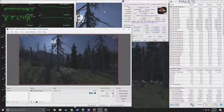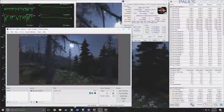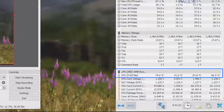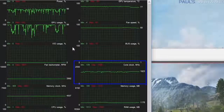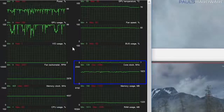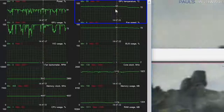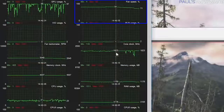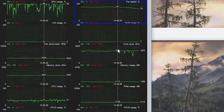In this test I saw an expected combination of results from the CPU stress test and the gaming test — the CPU was running warm but not terribly warm, and it wasn't throttling. It was running at about 3.4 GHz. The GPU frequency was hitting the same as in the strict gaming tests. Temperatures were about 82 degrees for the GPU, and when I pulled off the dust panel on the side they dropped down to 77 and were still falling a bit more on the GPU.